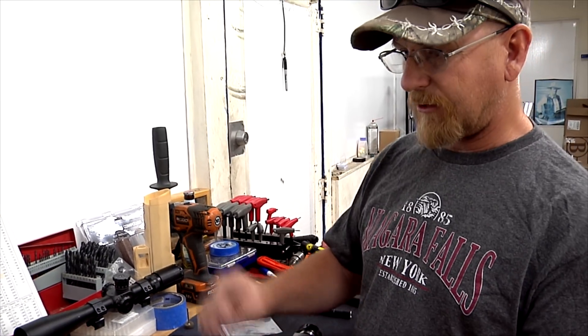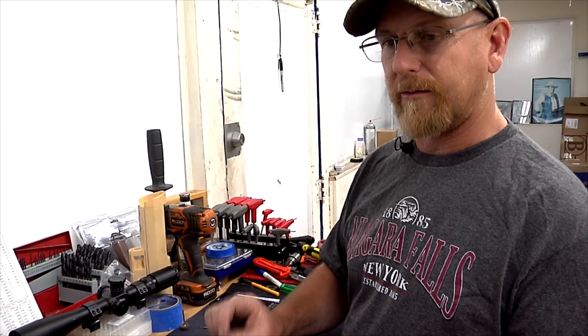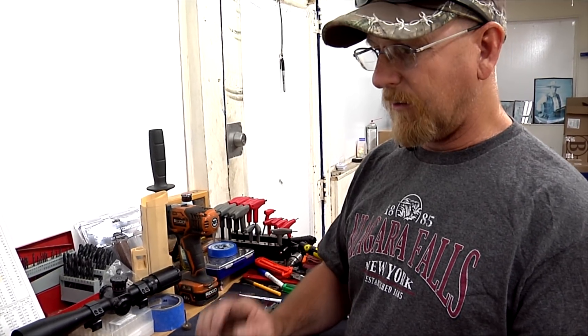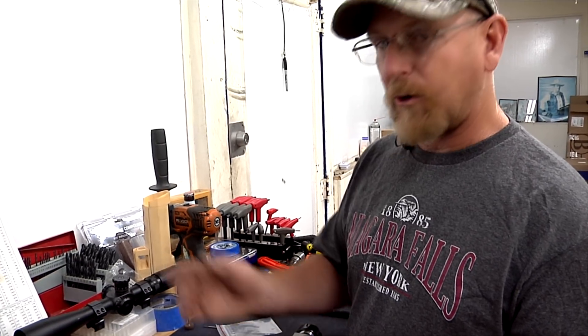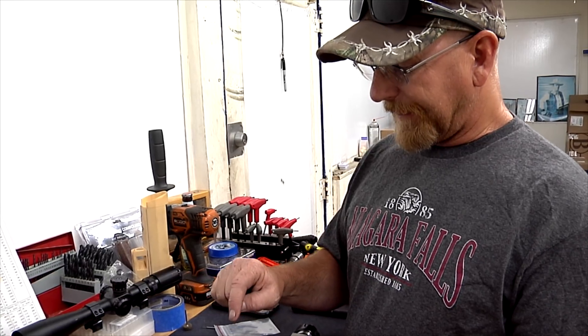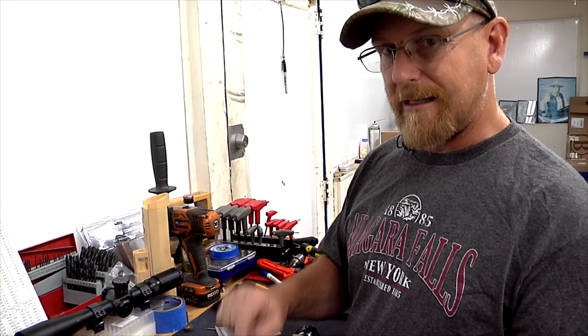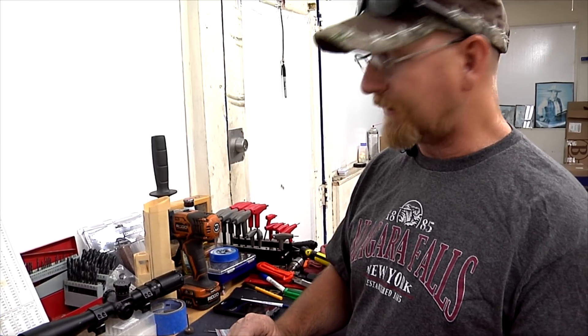The first thing you're going to have to do is take out the transfer port. There's a little plastic transfer port sleeve that's in there. We've already done that when we did the tear down, so go back and watch that video if you need to. The hole size that's in there when we're done is a really good fit for that N size drill bit.